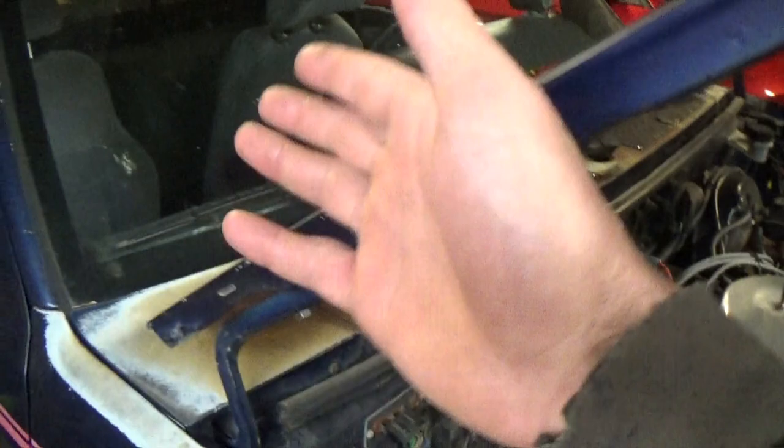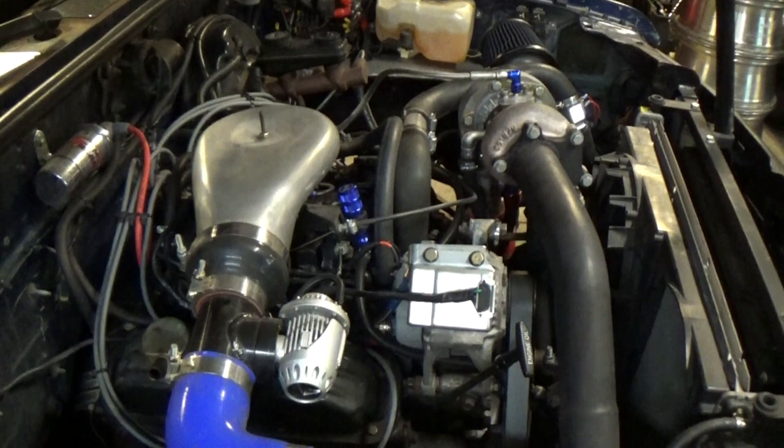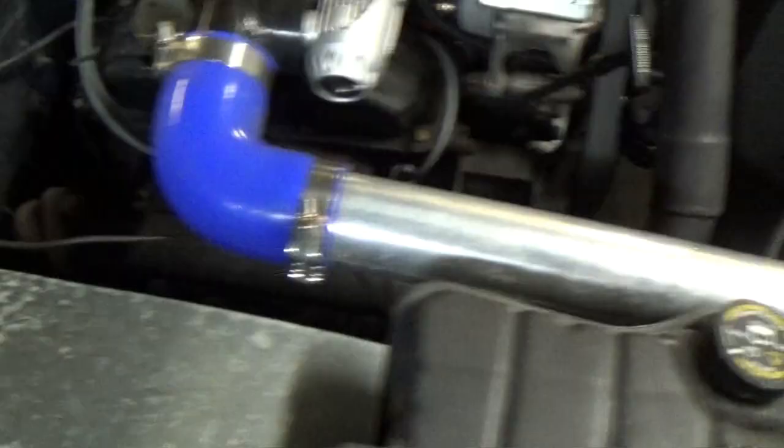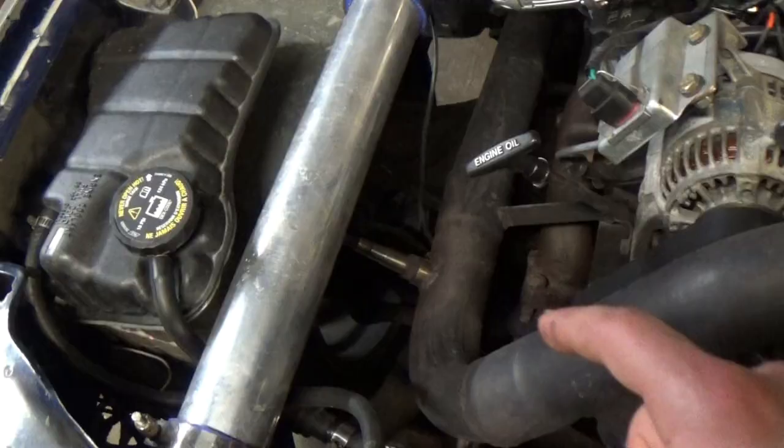This distributor would have been found in 1991 and older throttle body injection 3.9 liter V6s. You bolt it in, wire it up, MegaSquirt reads it, and you have crank position. Factory coolant temp sensor, air temp sensor, and throttle position sensor all work. You also want to run a wideband oxygen sensor — I am running an AEM wideband, which requires both the sensor and the gauge, since the gauge functions as a translator between the sensor and the MegaSquirt.